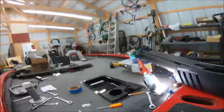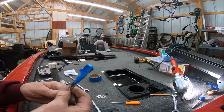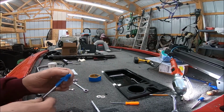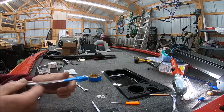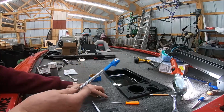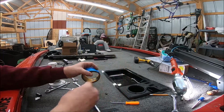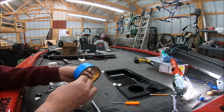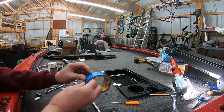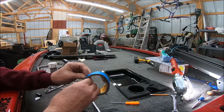Pardon me. I'm going to take this, I got taped in there. This is a nylon-insert nut, so they're self-locking. Just run it in, hold it in and feel, and I can get it started. Problem is, I've got to get these washers on here, and I'm using a double because it's not in the wood, it's on the edge of the wood. I could probably even get away with 5 fasteners, but if you're as anal as I am, that's unacceptable.